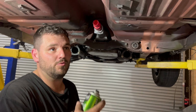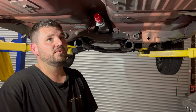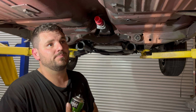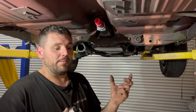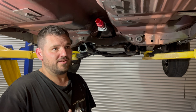So basically everything we've ground back to bare steel we seal with this so that it just doesn't rust in the future more than anything. We can weld through it all, it seals, it's not going to let it rust. Especially because these are all internal inside the actual sleeves, you never get paint to them. When we're done, we'll probably get fish oil or something of that sort, but still we need to make it so that's going to be right.